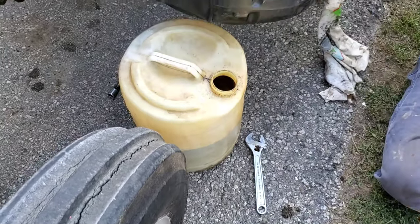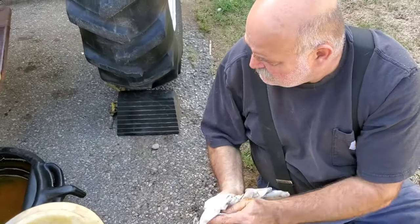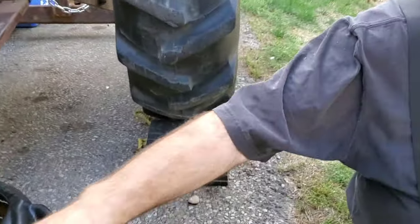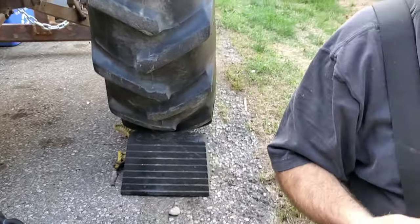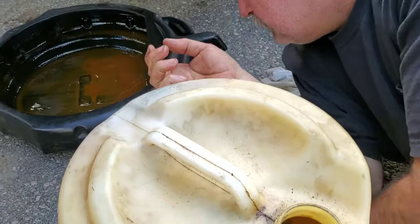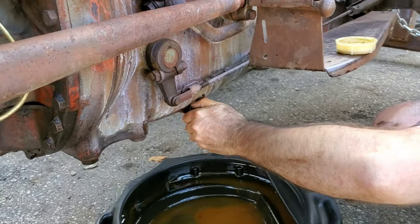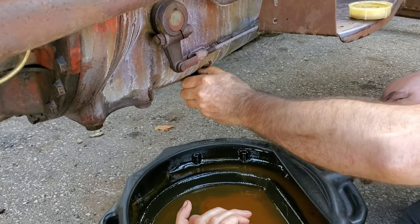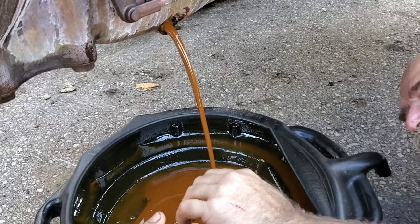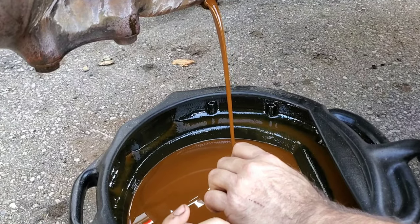I mean, there's load on the motor, but the load on the motor is via the PTO shaft, so you're not seeing that load on the differential. So my logic is to protect the differential at all costs, because that's the critical part. That's the part that's the weak, not the weak, but the vulnerable. That's the word I'm looking for. So obviously with that vulnerability, we want to do our best to take care of it.